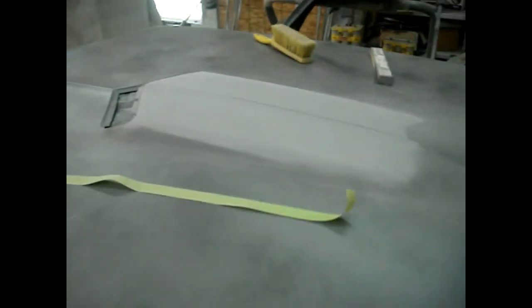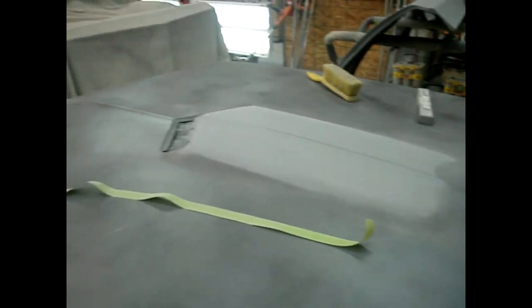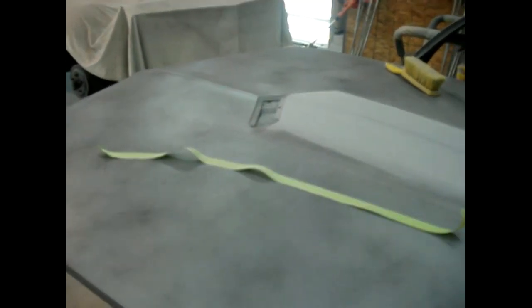Alright, we'll go ahead and finish this thing, get our sides in. Stand these hoods like this, especially with scoops, and I always like to start here in the middle. I'll sand these sides right here, and then we'll get onto the flat part of the hood. And we'll get this one knocked out and blocked. This will be the last block on this, I do believe. And we'll be ready for seal and paint. So I'll bring you back when we get that done.